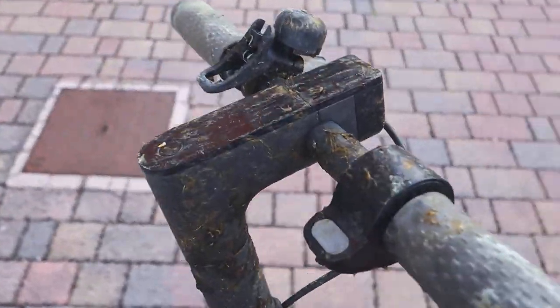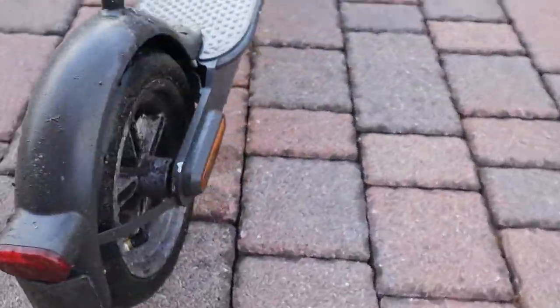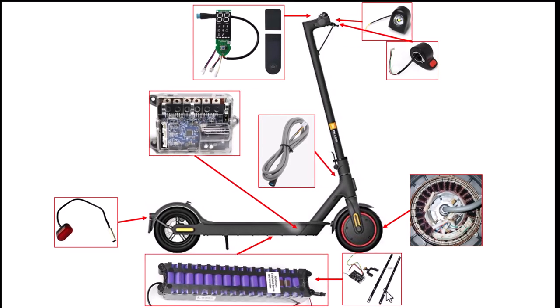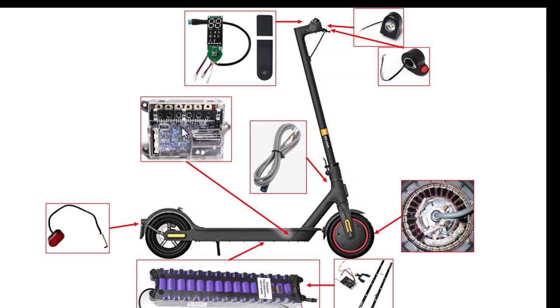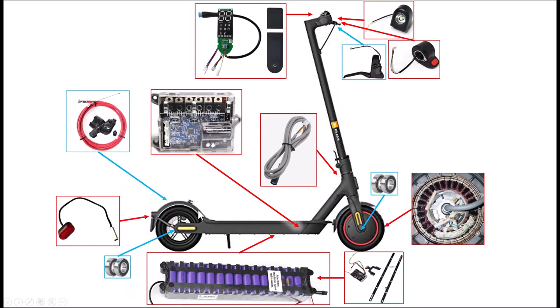Paint and plastic are kind of ruined. I see water inside the headlamp and in the rear lamp. So let's see if we can fix it. Let's see the parts that we have to check: first of all the electronic parts, which are batteries, the BMS and the PCB which are connecting all the batteries, rear light, front light, throttle, motor, main ECU, cabling and dashboard. But we don't have to forget all the mechanical parts — the bearings, the wiring for the brake, and the entire brake system needs to be checked, including the brake lever.